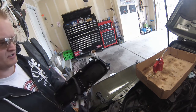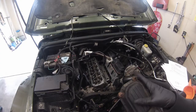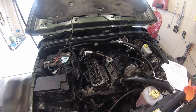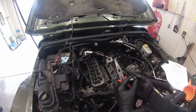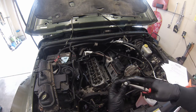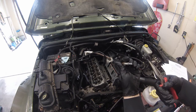Once you get this all off, there are also little rubber ones inside there. Once you get your old gasket out of your valve cover, these bolts pop out quite easily. But then you have this small, almost like an O-ring gasket on here. The easiest way I've found — you can either just kind of pull it with pliers, or grasp it, flip it over, and use the bolt just to pull it right off.